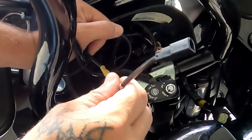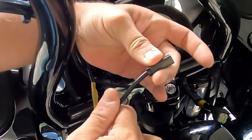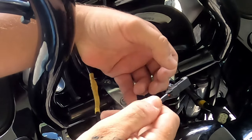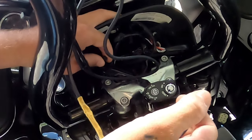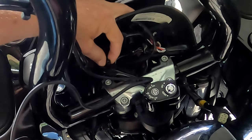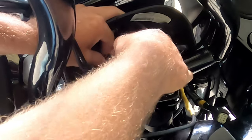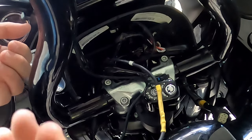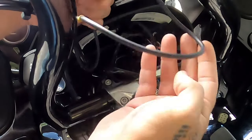The wire that came with the QuadLock — I just soldered it with heat shrink and put the heated grip plug end on it. Here's one thing I didn't know: this plastic piece is already on the bike, so you could take it down to Harley and have them put the two pins on. When you plug it in, your reds are on the right and your blacks on the left. This is the plug for the heated grips — just clip it in on the right side and now you have power to your QuadLock.